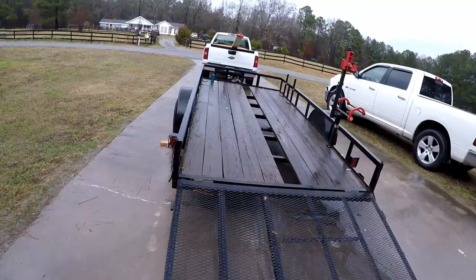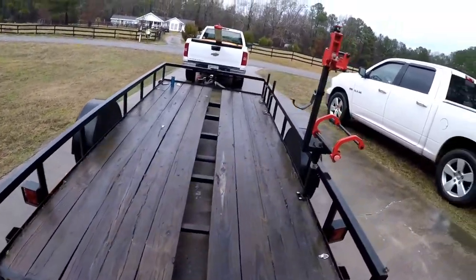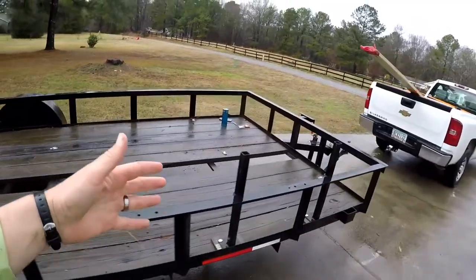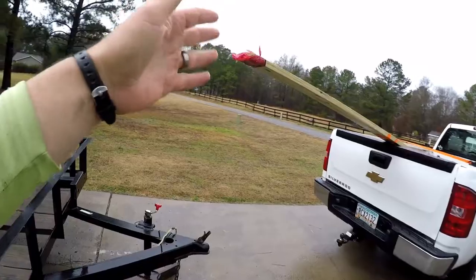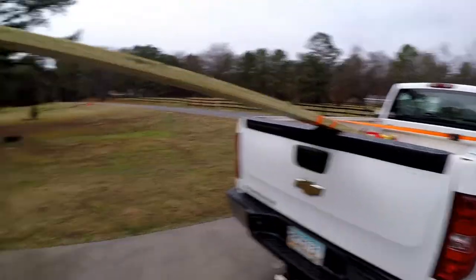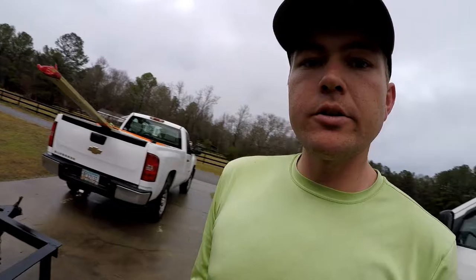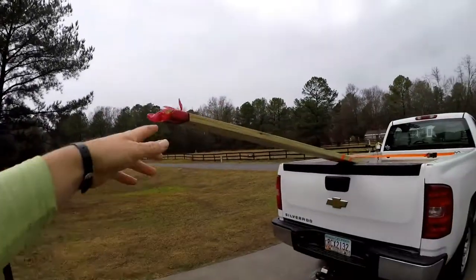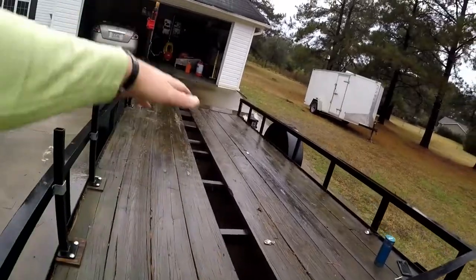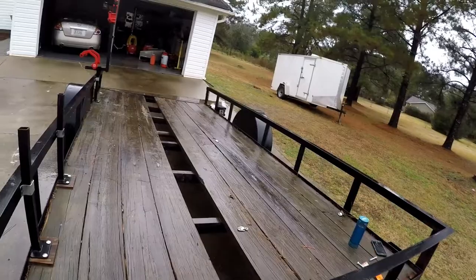Not hard — you guys can replace a board on your trailer by yourself, no big deal. This one's a 13-14 foot trailer, a little less than 14 foot. I got the exact measurement — I think it was 167 and a quarter inches. While I was at Home Depot, you know, they cut stuff for you free. There were guys right there already cutting another customer's board, so I told him to go ahead and cut mine too. That way when I got home it would already be perfectly the length I need.